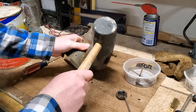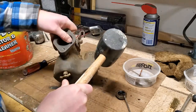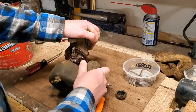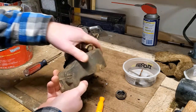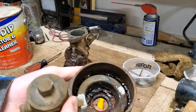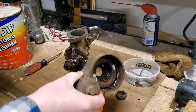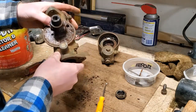I'm going to go ahead and tap this off with a rubber mallet. Okay, so here's the inside — that float is rusted down right now, you can see all up in there. Fuel definitely sat in it for a long time and then it evaporated away.